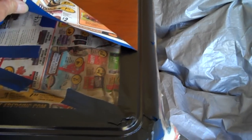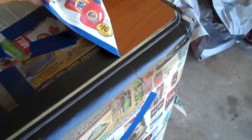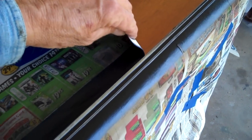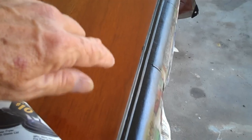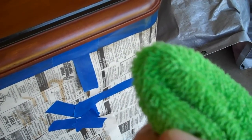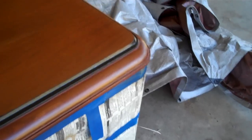Keep pulling toward the center, always away from the area you just painted. It's not going to be a thousand percent perfect but it'll be much better than it was. Go slow — if you get a little snag, go slow to figure out what it is. There might have been a little bit of toner that got in underneath the paper — we'll take care of that. I put a dab of lacquer thinner on a rag, almost let it evaporate completely. I'll blow on it a little bit to get it nearly dry, then very lightly rub back and forth with my finger to rub that overspray out — it should pretty much disappear.